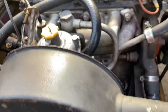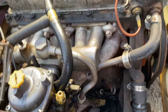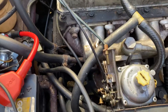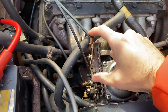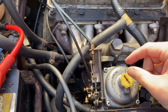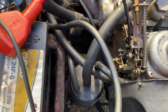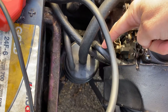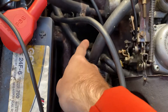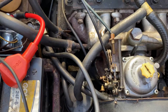And that's all assuming that the EGR would work — I'm not super sure about that. As far as attachments go, it looks like this is the throttle and this is the choke, so those would have to be moved over to the new unit. Also this vacuum line and this fuel line would need to be replaced. So there's a bunch of stuff that needs to be moved over.